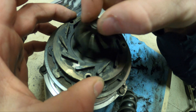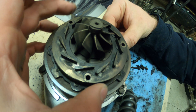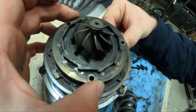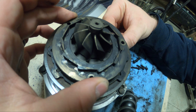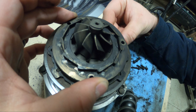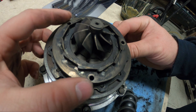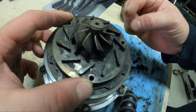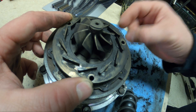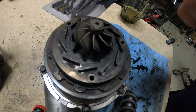The part that was stuck in my head incorrectly is that on a large truck these vanes would actually close all the way, and that's what causes a lot of back pressure — they use it for engine braking. A lot of the newer F-250s and similar trucks will have variable vane. The point is to limit the amount of boost you're making because it's inefficient, and then as they close you get to a point where it's as efficient as it can be. We'll go over the actuator when I reassemble it.